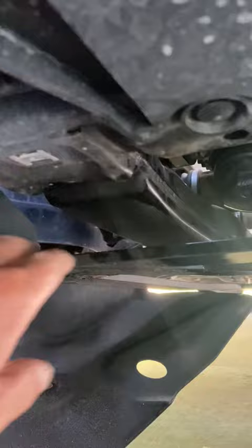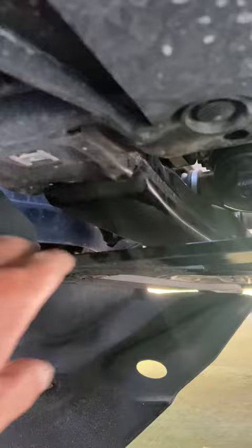What I found is you've got two 8-millimeter bolts — one goes here, one goes right there. Pull this down and you've got two T55 bolts that hold this cross-member and support. If you'll take both sides loose — four 8-millimeter bolts, four T55 bolts down here — it gives you enough spring to lower this down.